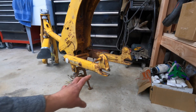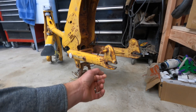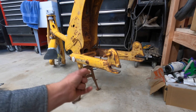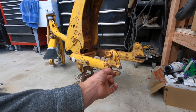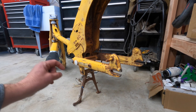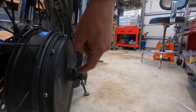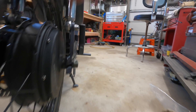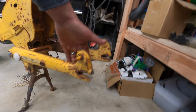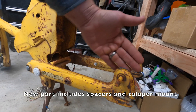Some of the C200s and C100 bikes have thinner dropouts. The CT90s have 12 millimeters, and those other bikes have skinnier ones. So if you don't reinforce these when you're taking up this space, it can break — as you can see in this photo. So I had to go through and actually add some material and really strengthen this bike to make it all work out. But we now have a much better solution. It's one piece — it takes up the space vertically and horizontally, and it also adds the brake bracket so you can mount the caliper right up to it. A cool solution.